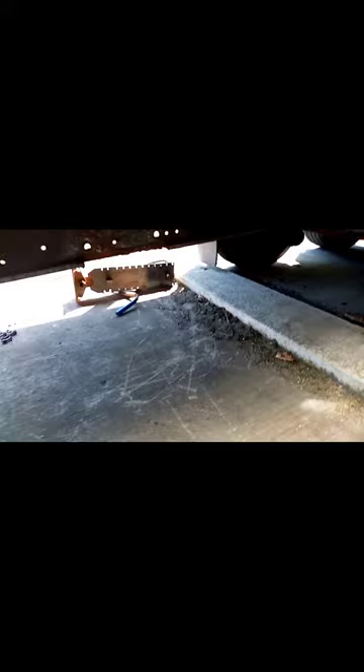I'm back at the customer's yard for the landing legs. This trailer had two bent rear legs which I took off yesterday. Robert's got the new ones here - top man - even comes with a cross shaft and a handle. You can see the big bend in both the old legs. These wheeled legs should make a difference because if they leave them a bit low and catch a sleeping policeman, the wheels will turn rather than having a flat foot plate.